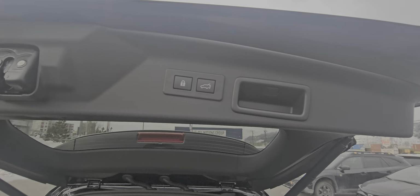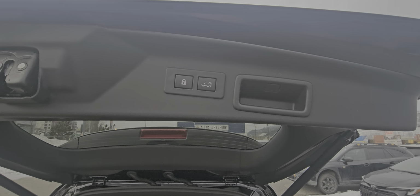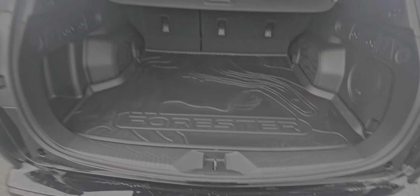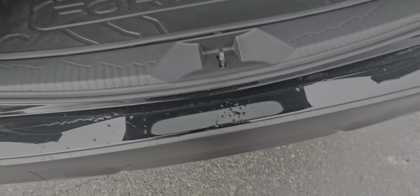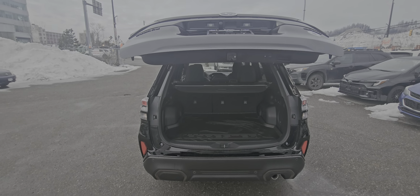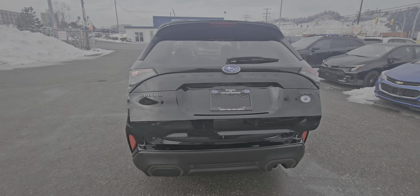Now, to close this, you can pull down, you can press the button, you can lock and close it, you can use the key fob, you can use the button by the driver's knee, or if your hands are full, you grab something out of the back, kick motion, and back up. It beeps 3 times, and on the 3rd time, it closes, which is very, very handy.